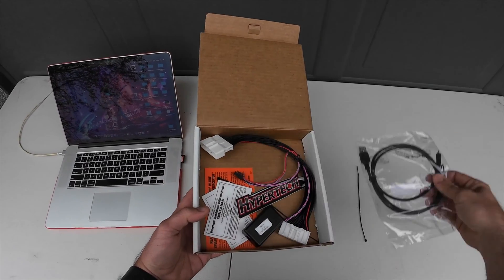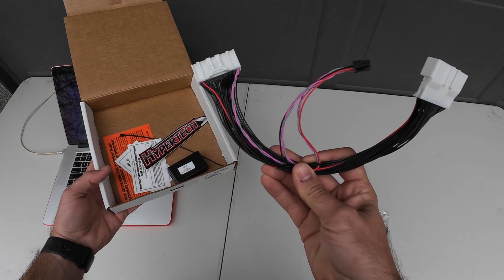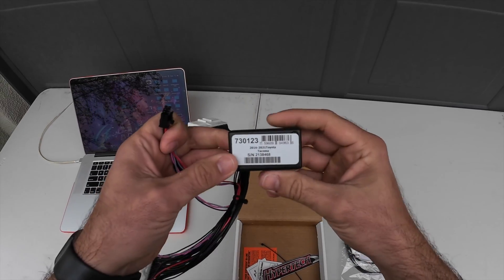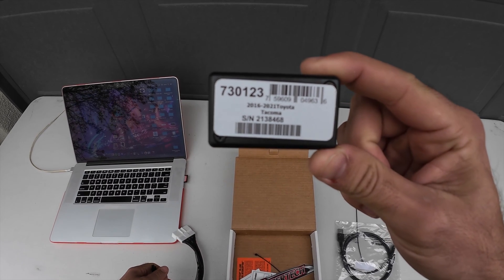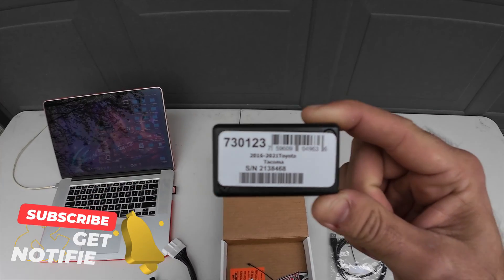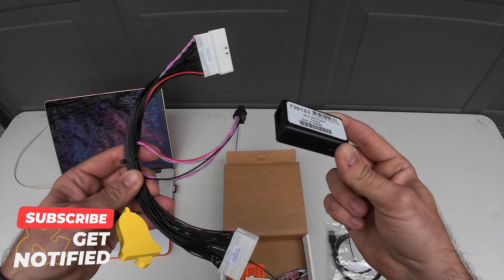What is going to come in the kit? The main thing is going to be this wiring harness. What we need to do is pull out the speedometer. This is going to plug into the back of it, then going to plug into the actual speedometer calibrator. Now what we need to do with this before we go and install it in the truck, we need to calibrate this. And then after we have that calibrated and programmed correctly, we will take these two components together and install them in the vehicle.